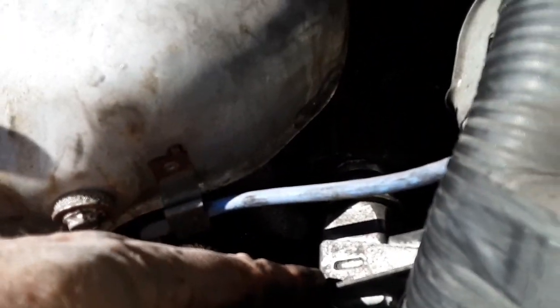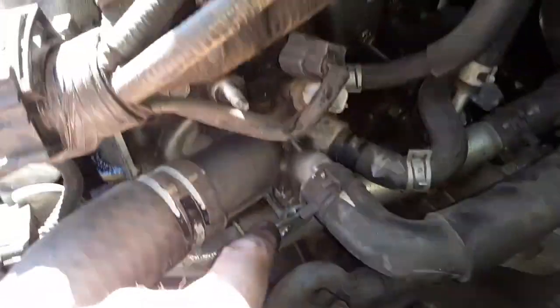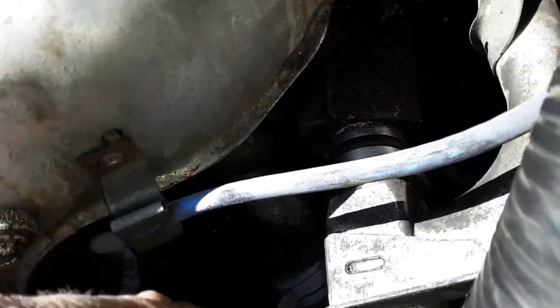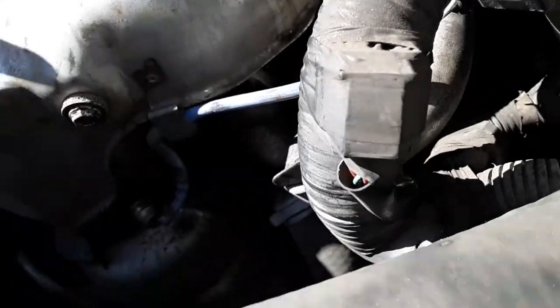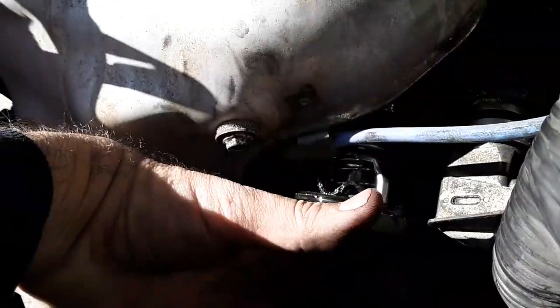This pipe right here has a bolt on the bottom, and you can see it's got an O-ring. There's also a bolt here holding it in. You get these bolts out, wiggle and pry gently, and you finally get the thing to come out. Then you can access the bolts down below. We're losing some coolant there — no way to collect that clean since it's dripping on the dirty engine, but we'll lose some. One of the thermostats or water control valves is in this housing here, and there are other videos showing this in more detail — my purpose wasn't really to do a full tutorial on this.